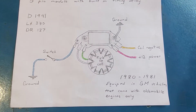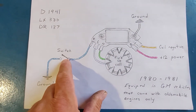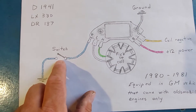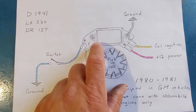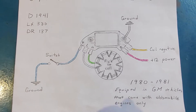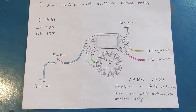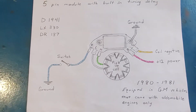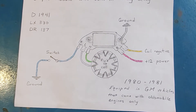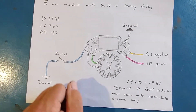There are much more useful ways to use this ignition control module. What I like to do is connect it to a regular little toggle switch, with the other side of that switch connected straight to ground. If you close that switch, you're going to retard timing five degrees. One of the most useful ways is if you want to change fuel quality — say you go to the gas station and put in the cheapest low-octane fuel. You can close that switch and it'll run five degrees less advanced, which keeps your engine from pinging and knocking. Too much pinging, knocking, and detonation can damage an engine.